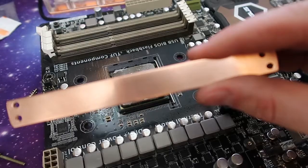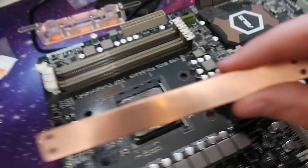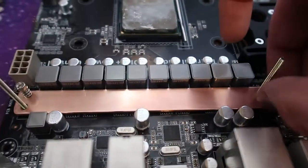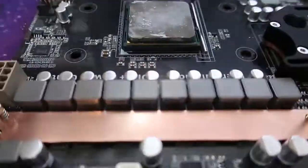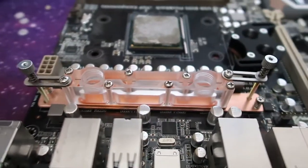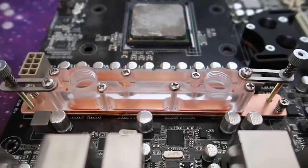When I was trying to work out how to mount the water block on top, I realized I needed to put a couple more holes there, so I drilled those out. That allows me to run some screws up through, and then I can screw down the water block onto those screws. First I used the original screws which held the copper bar down into the motherboard — the exact same spot as before. Then I can slot the water block on top of that and screw it down. The heat will transfer up into that copper bar and then up into the water block and go into the loop to cool down all of those transistors.